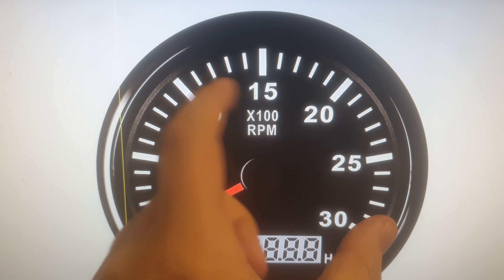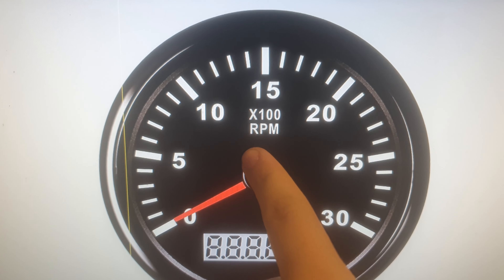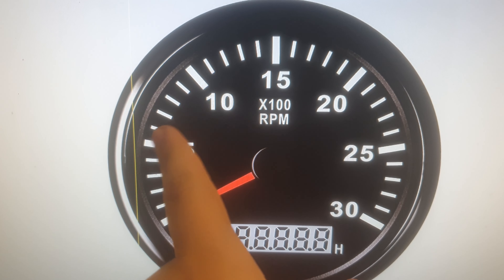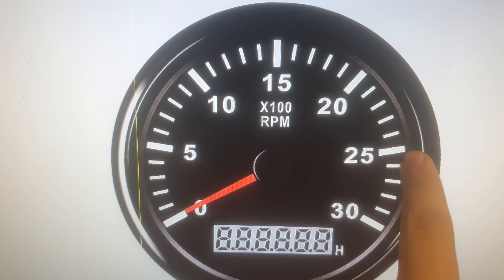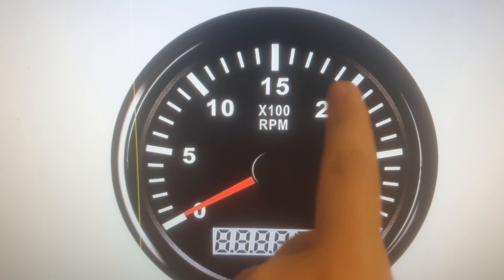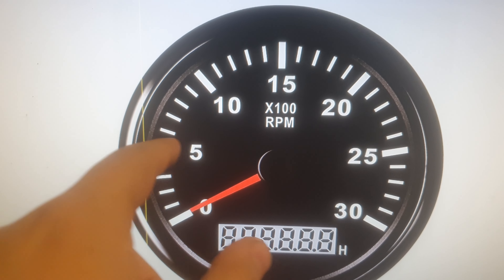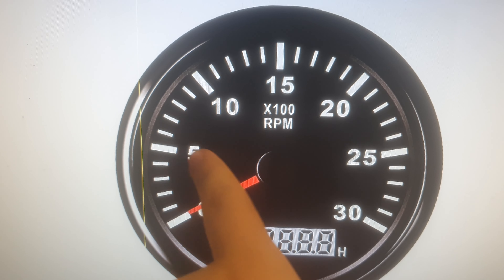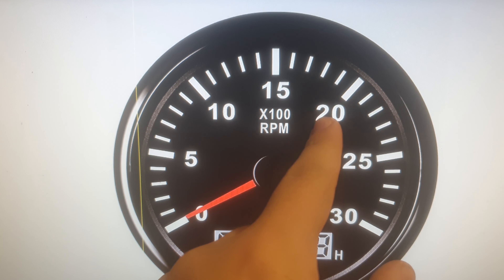This is not a speedometer or RPM gauge for either of those cars — it's just something I found on the internet to show you. If you drive a diesel car, don't focus on the max. It usually has a red line here — that's the max, and the last section is typically red. If idling is here, maybe it shows 10 or 1000 for you, so wait until it reaches double that idling RPM before shifting.